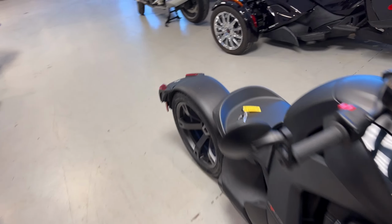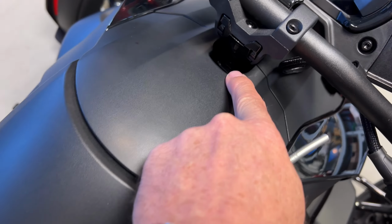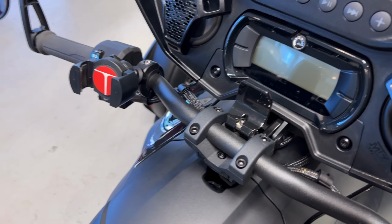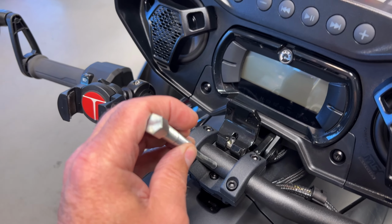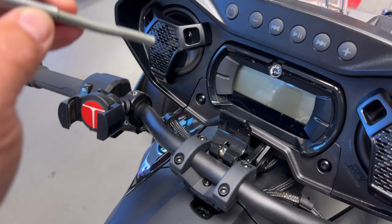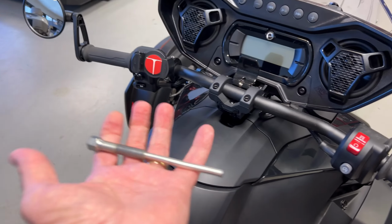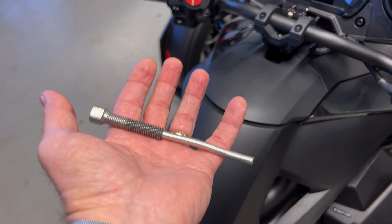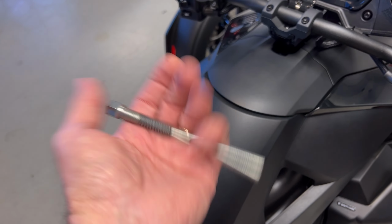And what this does is underneath there's a cap, and then the bolt that holds the upper tree or the upper stay into the shaft. Well, you run that thing down, and by hand, you tighten it down, and boom, it pops it off. It's like knocking a flywheel off. Or the best way, this is a setup like a clutch does, like the primary clutch on a snowmobile or side-by-side or something like that. Just a small version of it.